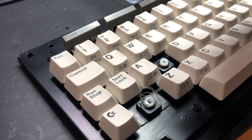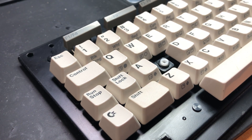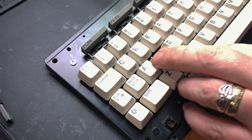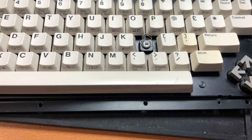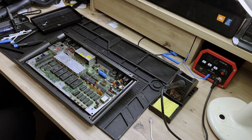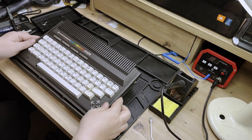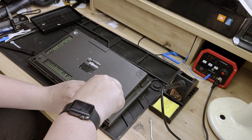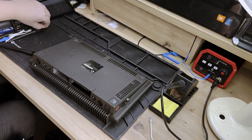Before you know it, all we need to do then is put our missing keys on. Those actually prove pretty easy and they're in great condition — they match really, really well and I'm really happy about that. And as our last key goes on, it's time to reassemble the machine and see if it's working. First I have to put in the rather industrial keyboard connector — and I really wish more 8-bit micros had a connector like this. I'm looking at you, ZX Spectrum. Then all we have to do is add the case screws back in and the machine is once again back together and looking okay.